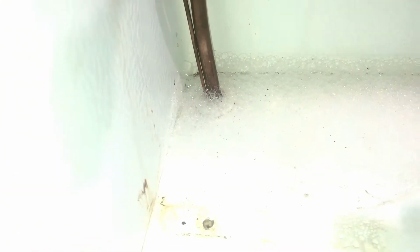That is from when I was cleaning it. There's some suds. So you can hear the refrigerant moving. Totally normal. Also, that is a screen. Make sure you keep that there. And it's good to pour a little bit of water down in the drain tube, maybe a few ounces, and that keeps warm air from traveling back into the freezer. And that would also help to keep your door from being so difficult to open as well.